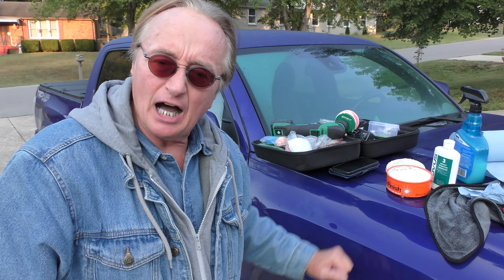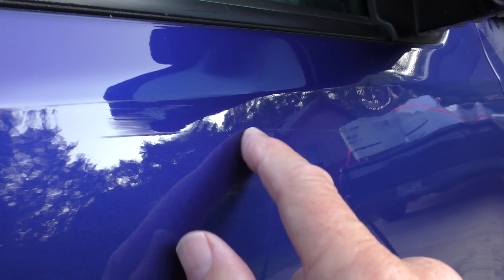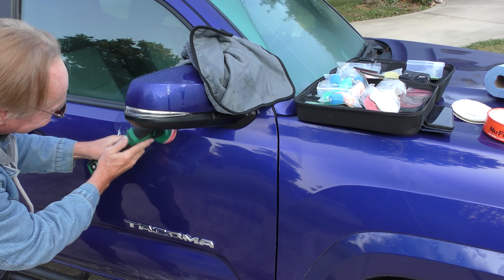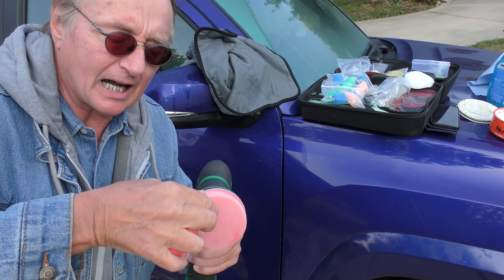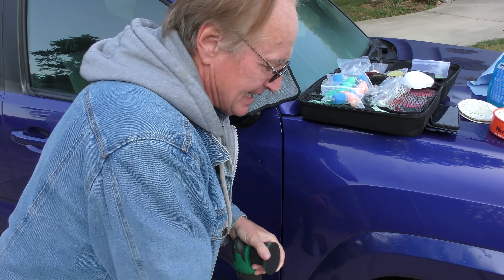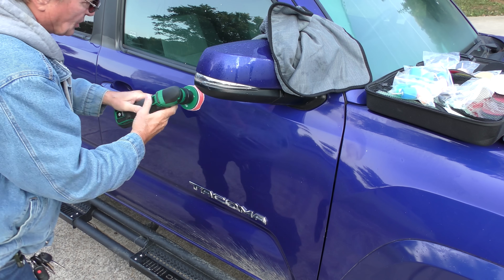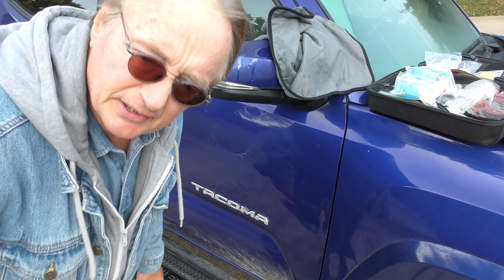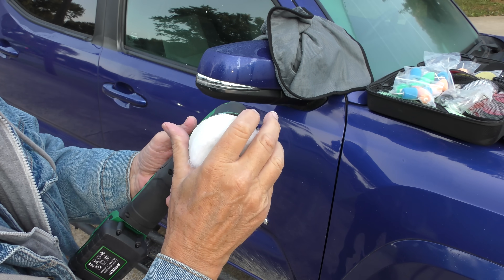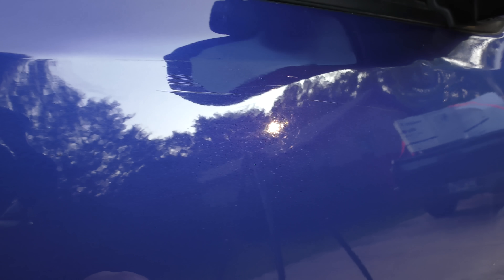So in this case we're just trying to polish it off. Wipe off what we've done so far and see what's happening — it's getting better, but you can still see scratches. So we're going to try a little of the heavy duty scratch remover and start polishing that. Once you do the heavy duty stuff, you're going to take this pad off and put a new clean one on, then buff it again with the fine polish. When you really think it's starting to look good, put the fine buffing pad on next — it just sticks on — and buff it.